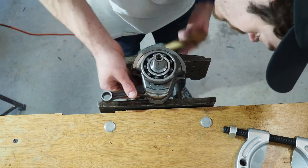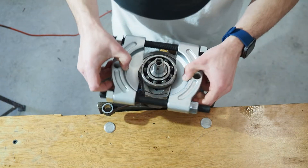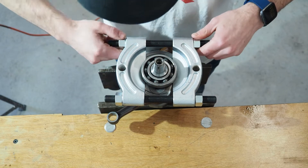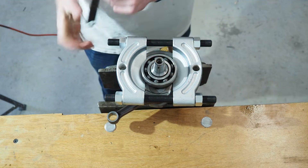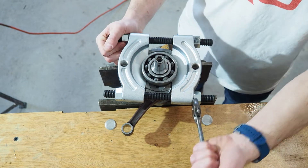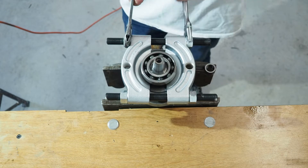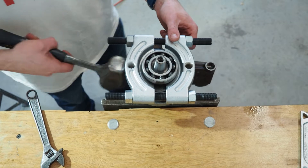It's definitely something I'm going to have to replace, which is a pain for these crankshafts. They're a two-piece design, so both of the lobes and the crankshaft are separate. There's a shaft that they press into both sides of the crankshaft with the connecting rod on it with a bearing inside. So you have to pry the crankshaft apart to get that shaft out to remove the connecting rod — and it's a whole process. I don't have the machinery. Even with a hydraulic press, I don't think I could do it. You really need a special machine to do that. And when you reinstall the new shaft, you have to get the alignment of both lobes horizontally — parallel to each other — absolutely perfect. Or else you'll have some really weird issues with kicking the engine over when you rebuild it.